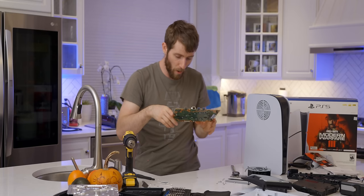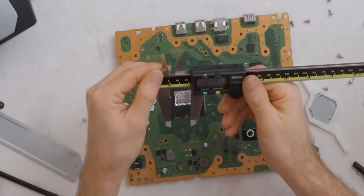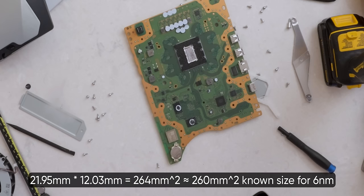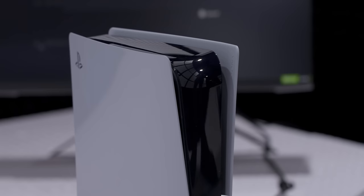Moment of truth — where's the caliper? What's the size of the six nanometer full-sized die? 260 millimeters squared. We're measuring 21.95 by 12.03 — that's 260. It's the same die then, which means that having the exact same power measurements makes a ton of sense, because functionally this is the same PlayStation 5 refresh, just in a much smaller chassis. I see a lot of people saying they don't like the look, but in my opinion it's a better-looking chassis.